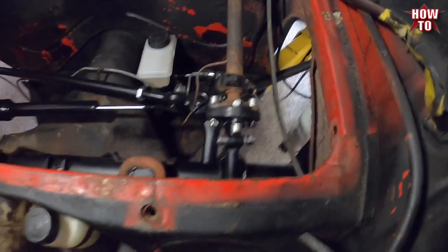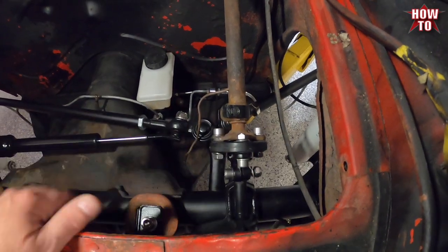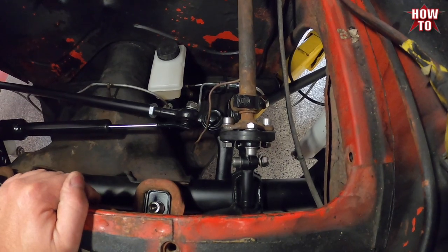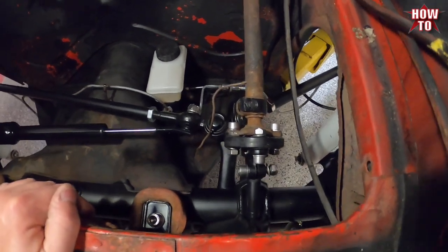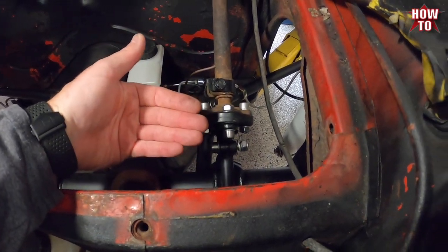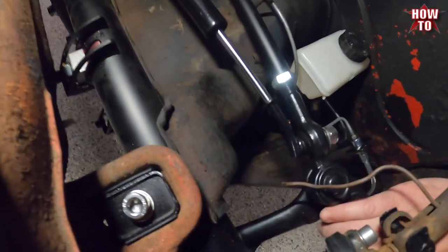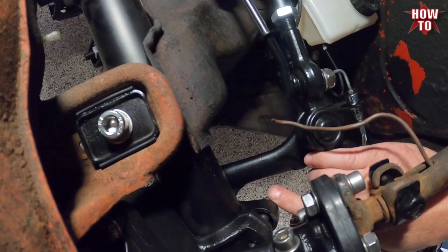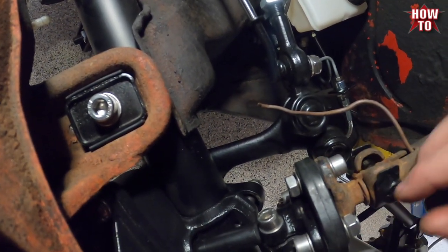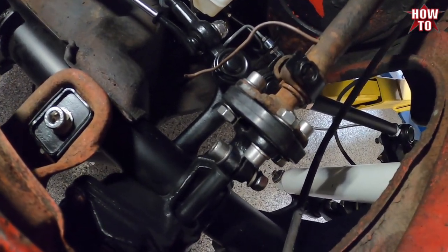All right, so we got the steering connection. All the parts just kind of loosely fit in there. And we're just going to fine tune this for this vehicle. This portion of the steering box needs to come up. So, oops, we're going to loosen this bolt and we're gonna tighten the other one, and it's going to rock the steering wheel. It's gonna rock it up. And that will make this more even. And then,